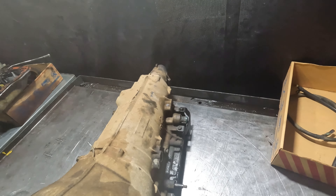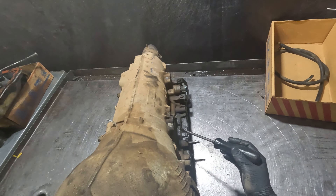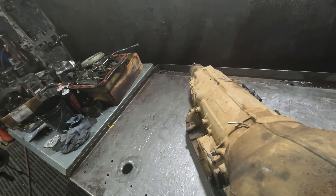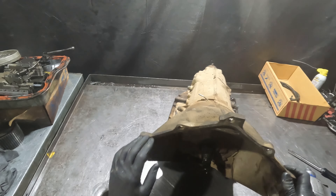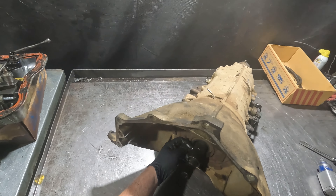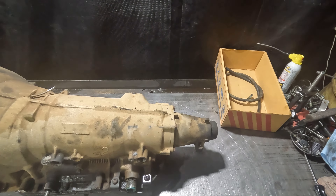This unit came in from a local shop. It's got some really interesting stuff going on. Number one, the sensors are missing and it looks like melted plastic — looks like it dripped down the side of this part of the case. I've never seen anything like that. It is a 2003 rear lube, I believe out of a van. I can tell the pump stator is bad right off the rip. Needs a new pump, at least the stator — it's got a big cut in it. It's a stinky one too, it smells terrible. Let's get into it and see what's going on.